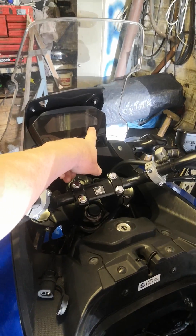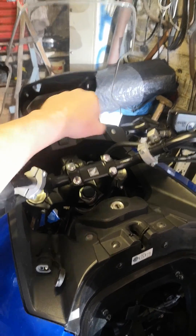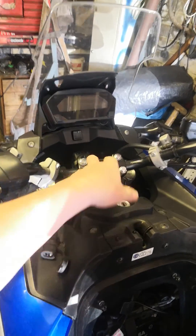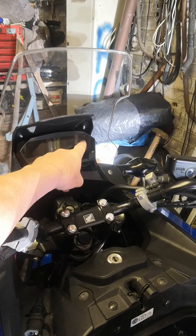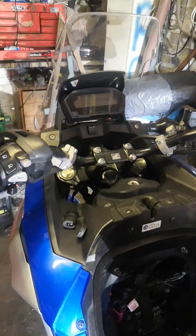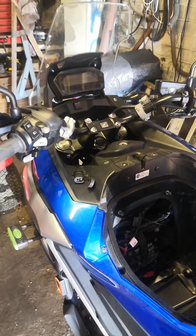Put it back onto the positive and wait till it starts to flash. I got four flashes, which I think means it's in programming mode. Take the original key out, move it a couple of meters away, put your new key in and wait for it to flash. I left it in there for about two minutes — it was flashing four times — then took it out, connected it all back up and away she went. Just a little tip there, thanks for watching.